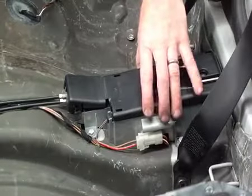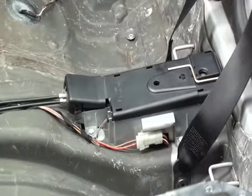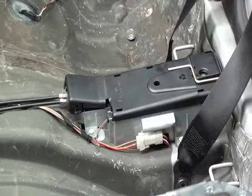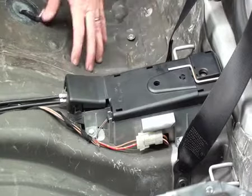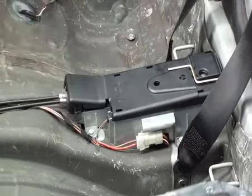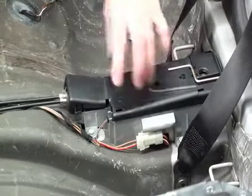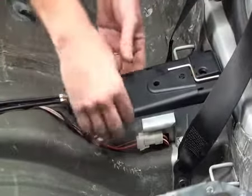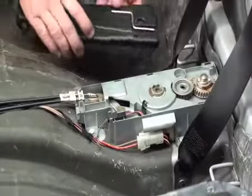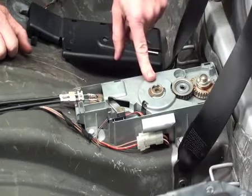This here is the motor assembly that opens the latches for the convertible compartment to actually allow the roof to come out. The way this works is an assembly is in here with gears. There are two bowden cables which actually go to the latches which either lock or unlock them. You can pull this out — that opens up and there are five clips in here. You just lever underneath here with your fingers and that will pop straight off. You can see you've got the assembly here which does all the work.